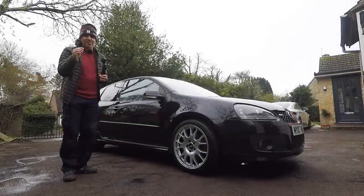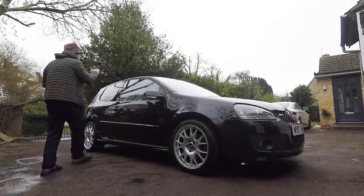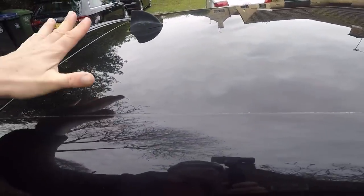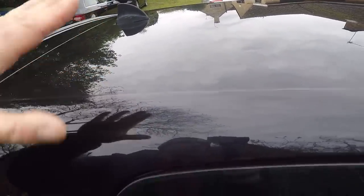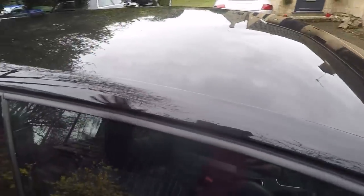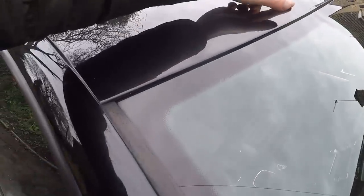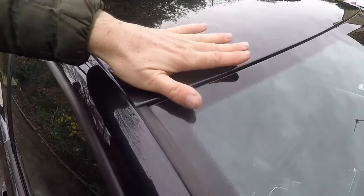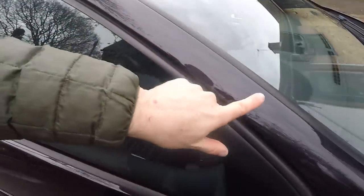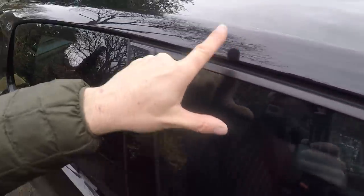The light's not ideal for inspecting paintwork, but at least the car is clean and dry, so let's have a go. I always start at the roof, because it's easy to overlook this, and any damage here can be quite expensive to sort. You usually get damage from bird poo, or from roof bars being fitted, or just dents from things landing on the roof in people's garages. Also check the front of the roof for stone chips, because it is quite exposed and they can get quite bad quite quickly here. While you're up here, check the A-pillars for chips — nothing really to report here, so that's all good.